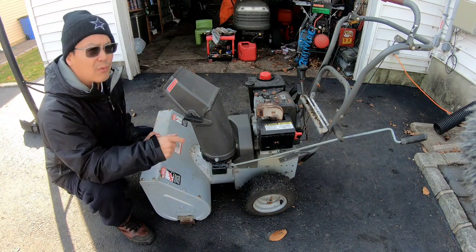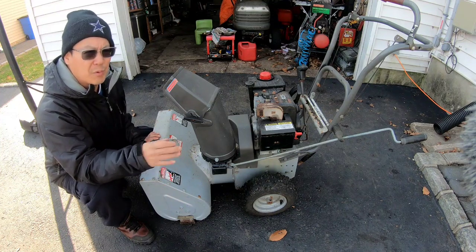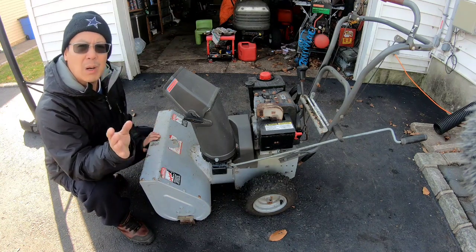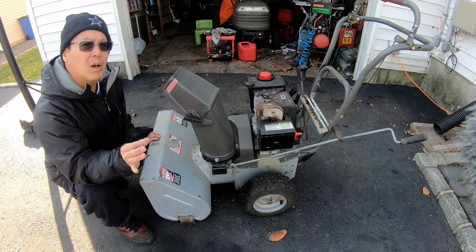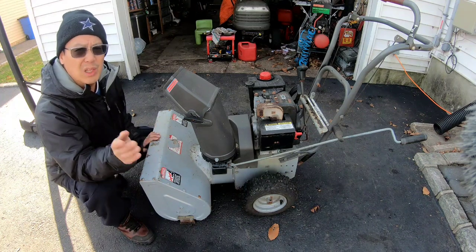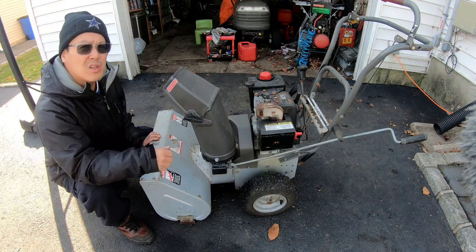But first, I got a text from my friend Nick Irardi over in West Islip. And he has a blown Kohler Courage 21 horsepower engine with a hole in the block for me. As you know, I recently rebuilt the Kohler Courage engine, 19, 20, 21 horsepower, somewhere around there. But I always thought that the twin camshafts I put in there were a little hinky because they didn't come with an ACR compression release lever on them. So I have a feeling that when I'm ready to put that rebuilt engine onto something, it's not going to start because it doesn't have the compression release. So in case that happens, I could use Nick's engine's cams or compression releases if he has them too. So I'm going to go over to West Islip right now and pick it up.